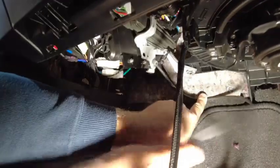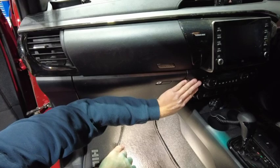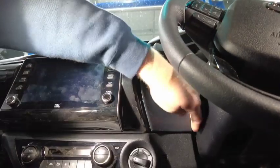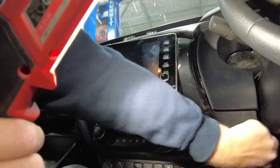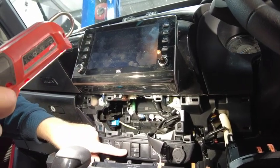We're going to run this remote wiring harness across toward the middle of the vehicle where we'll install the switch in the centre, in front of the gear selector. To remove this panel, we're first going to take away the air conditioner control panel. We need to remove the plastic shroud around the instrument cluster at the lower left corner alongside the steering wheel — just pop that by pulling up at the bottom. We're now going to remove this entire section in one piece by pulling on the right-hand side. That's given us clean access to route our wire up, and we're going to push out the switch blank to install our TowPro control knob.